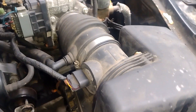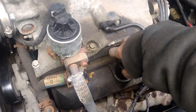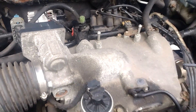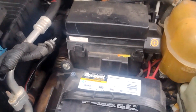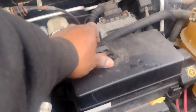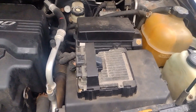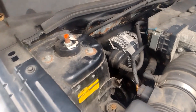Now all I got to do is install the battery. I still got to put that cover on — we're going to put the cover on now. Remove the oil cap, sit the cover on top — it's got little slots it sits on — push it down, and this holds it on the other side. I went ahead and dropped the battery in, got one side on, got the negative connector on, then dropped the hold-down strap on so the battery doesn't be flopping around. Now I got everything in place: battery box is in, cover is on, air box on, alternator installed, belt in stock.